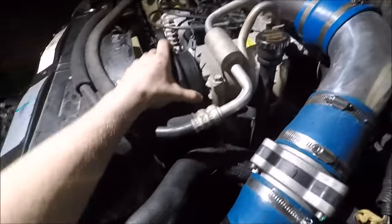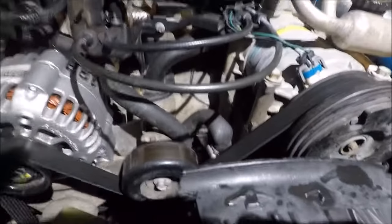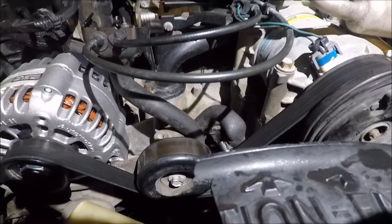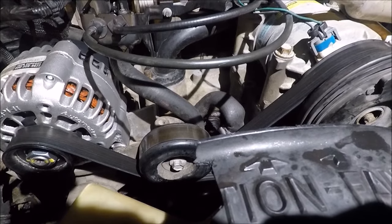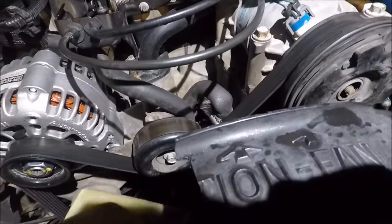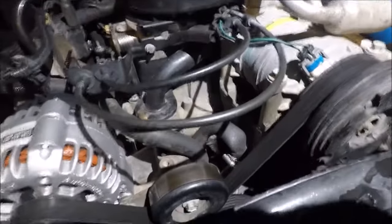Common things that are known to go bad: the AC compressor sits right on top of the engine — you don't have to dig way down into the engine bay to find it. They still use a version of this engine today, though it's not manufactured by GM anymore — they discontinued it as of 2014. It's now manufactured with a different displacement by MerCruiser for marine applications. They bought the prints and rights, tweaked it, increased the displacement to 4.5, and now it powers a lot of boat motors.